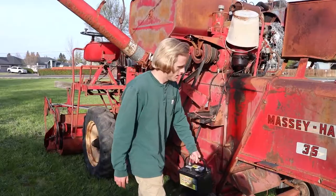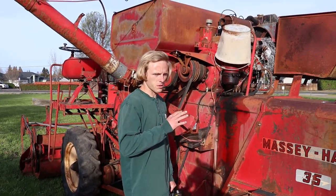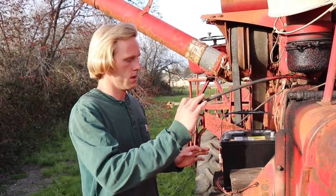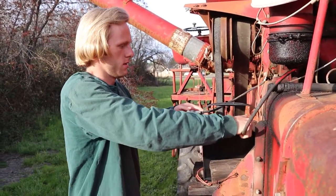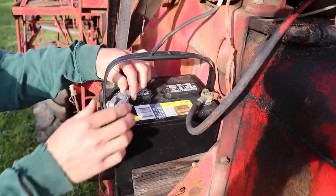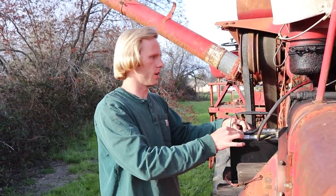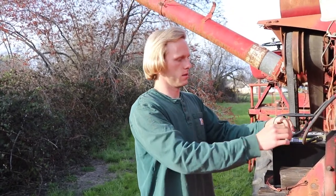I again don't know if this is 6 volts or 12 volts, because the alternator might be a 12 volt alternator but the coil is 6 volts. Something I forgot to mention — I looked at the points and they do look like brand new points. So we're gonna connect negative to ground and positive first, hopefully this thing's not in gear and doesn't try taking off or something crazy. What else makes me think this has been changed is these battery cables don't look that old — if they were from the 1950s they would not be in great shape.